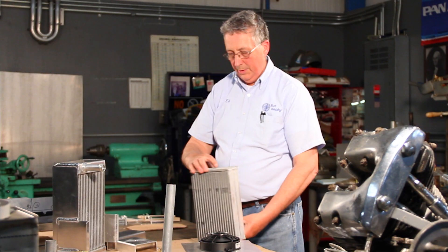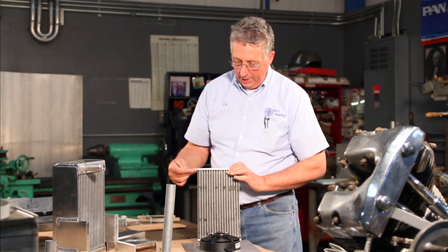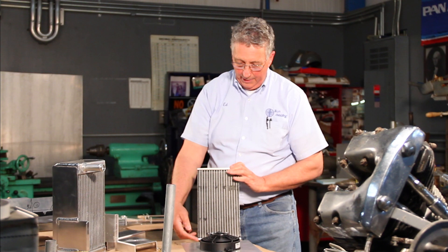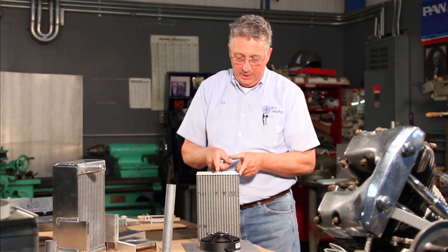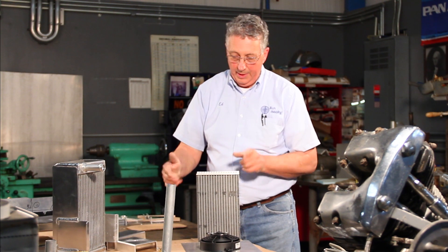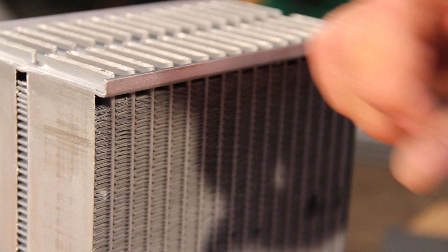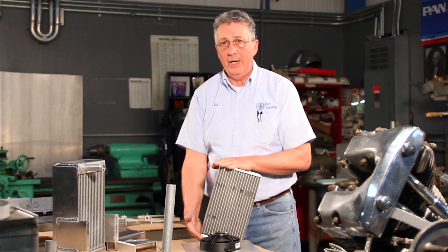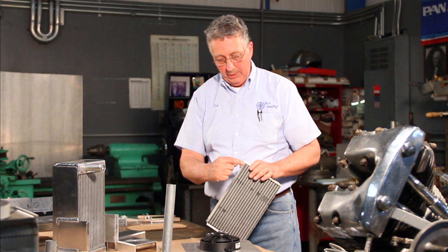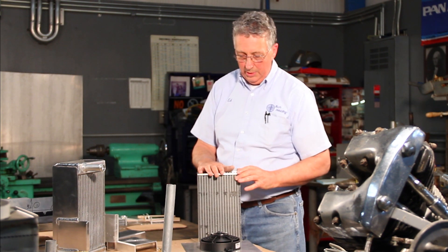What happens is this is the way I get the cores. Being that I'm building two radiators of the same size, this is what they call header to header, or tank to tank. I can cut the core down this way to make you a radiator this big or that big. I can also cut it down this way, but I cannot cut it down this way — this is a locked inside size by the manufacturer, because what they do is they weld these tanks on with a special process.